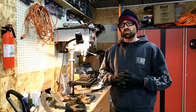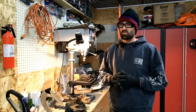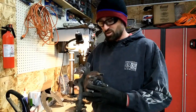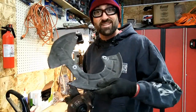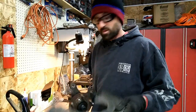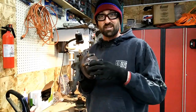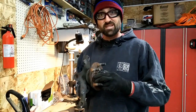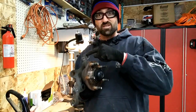So I sourced a set of 94-95 spindles off a GT, and what I got was kind of mixed. The 97 GT spindle I knew I couldn't use because it requires a bump steer correction. But they had great dust covers — the backing plates. Also on the 97s, because the spindles are the newer non-serviceable style, they're actually in pretty good shape. I just need different spindles.